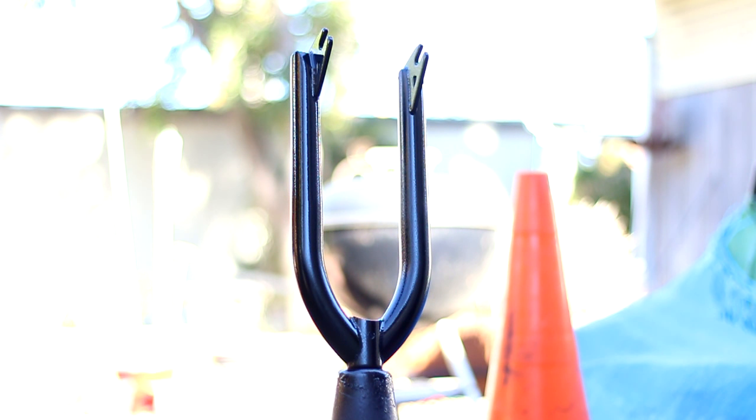That's the third and final layer. Just going to let it dry for a bit and then put them on later. Usually you want to let parts dry for about a day, or better yet a couple of days — like three or so — then the paint will be fully hardened and a lot less likely to get messed up easily. That's how you paint a BMX part the easiest and fastest way. It really probably took me about an hour to an hour and a half. The paint stripper makes it a lot easier. Thanks for watching.